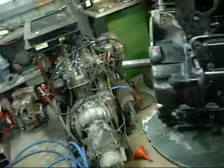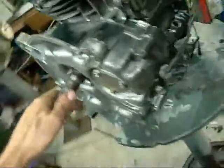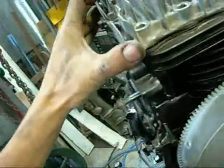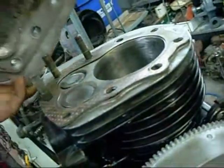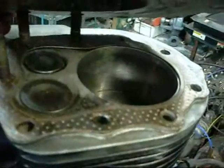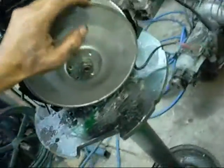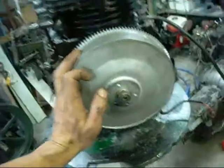G'day folks. This is a Honda 400cc vertical shaft engine. I'm currently working on getting it going. I'm lacking head studs and a good head gasket, so I'm going to buy a gasket for it. I've just done honing the light surface rust out of the bore and re-lapping the valves — usual story. It should be a pretty good engine; it's got good compression.